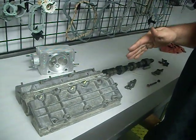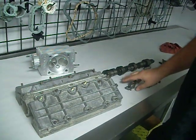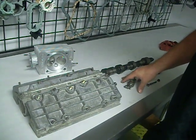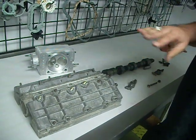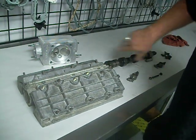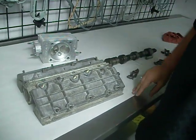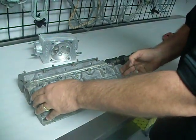On an over rev, you may bend the valves just slightly, and you won't hurt the rocker sometimes, or you will. But usually when I open a motor and it has a big old kiss mark on top of the piston, and the other 5 pistons there's no markings, that's usually a misshift. When I have a kiss on all the pistons, it was just being taken too hard and all the valves kind of smacked.